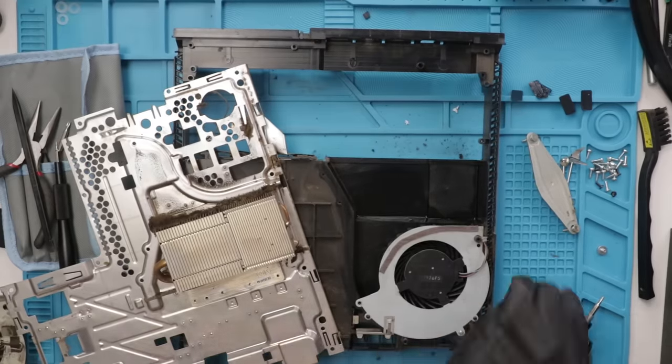The good news is that number 12 also has the blue light of death, and on the PS4 Slim that's not normally fixable with washers — I've never gotten it to work. So I'm going to try putting a different hard drive in it, as every once in a while that will fix the blue light of death. If that doesn't work, then we can use this entire console for parts to fix number 11. New hard drive installed on number 12 — let's see if it turns on and shows up on the TV. Unfortunately for number 12, it does not show up on the TV. The blue light is just constantly blinking and I hear no noises from the hard drive, so unfortunately number 12 is dead. The good news is we can steal the hard drive from number 12 and put it in number 11.